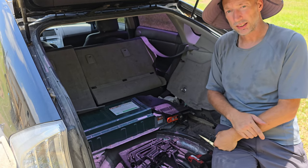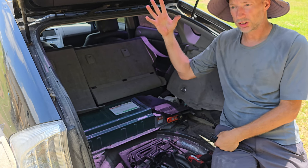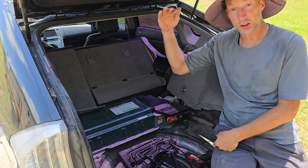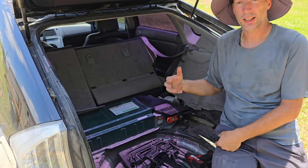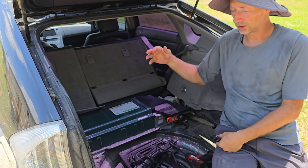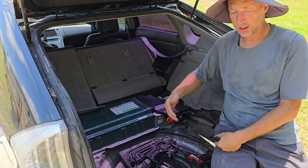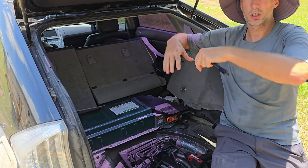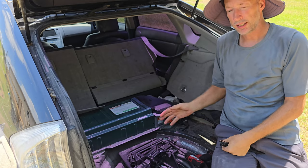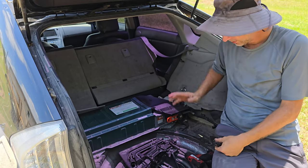Now, those batteries, as they run out of charge, the voltage goes down, 12.6, 12.5, 12.4, 12.3, it just slowly degrades, and that's what tells the alternator to kick on. It sees a certain voltage, and the voltage regulator says, hey, it's too low, let's do our thing. And that system comes to life, it charges it up, everybody's happy. That's what's supposed to happen here.